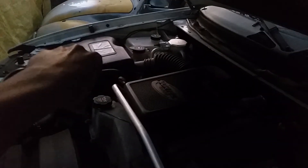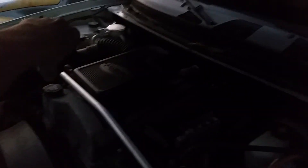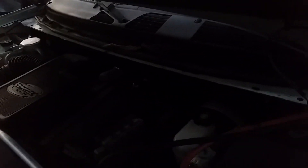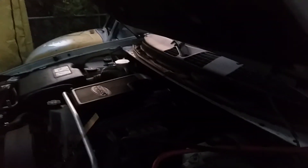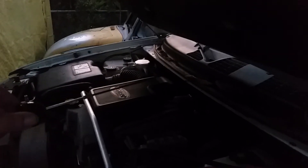I'll put it up top above the valve covers and listen to see if the noise is loudest from that point. I'll also put it underneath the bottom or on the manifold. I ended up figuring out it was loudest right underneath the bottom, from the center of the oil pan. That's how I know it's got a spun rod bearing.